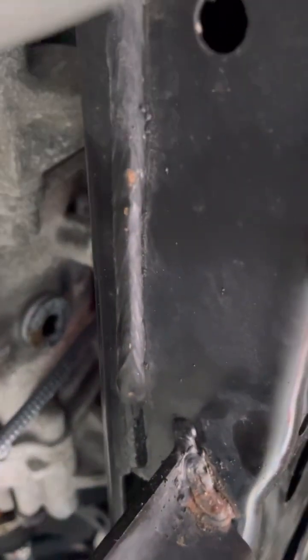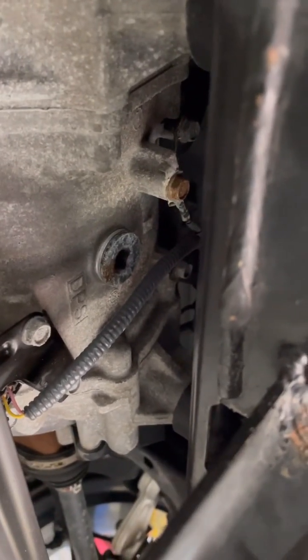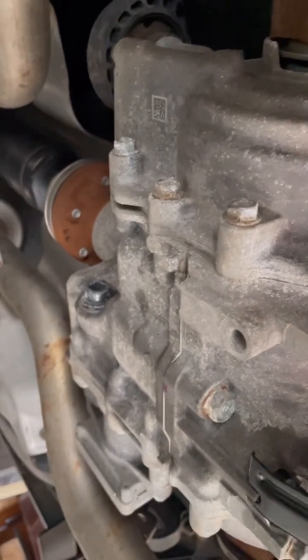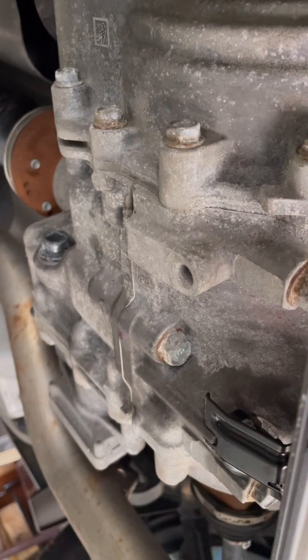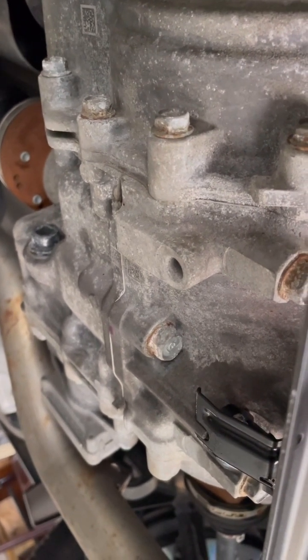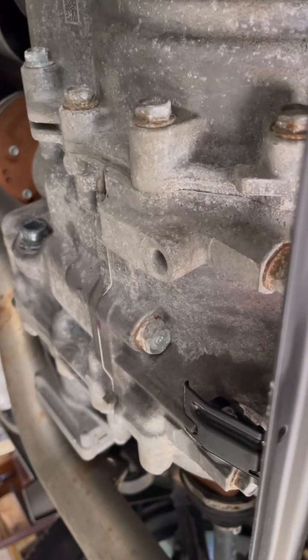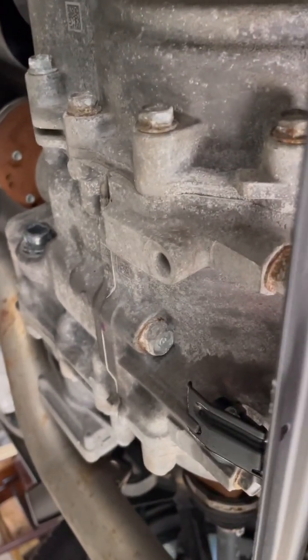All you do is use your torque gun — it pulls pretty easy. Loosen that so the fluid can get out, then get your pan under it. It drains out just like changing your oil, drains right out into the pan. Now you've got to change the washers, of course — typical situation. It torques back to 35 pounds, so you need 35 pounds to torque back with new drain plug washers.